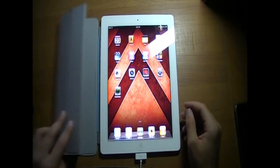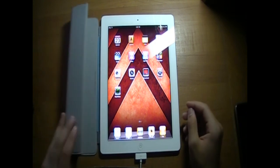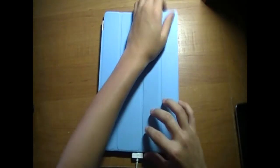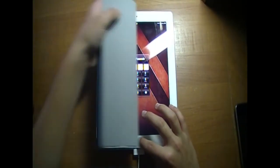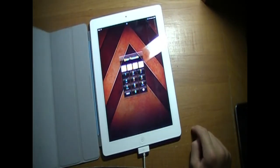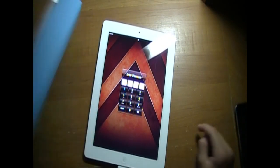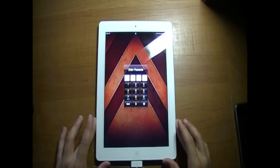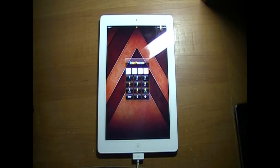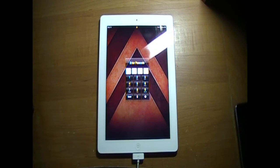Except it doesn't have the camera and stuff — not going to get into that. But you're going to want to make sure when you're getting into DFU mode you're not going to put the device to sleep while doing everything, so you want to have the device open the whole time. You're going to need your iPad and your USB cable plugged into your computer with iTunes open.